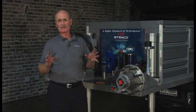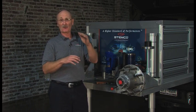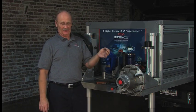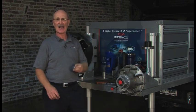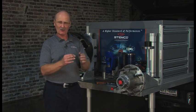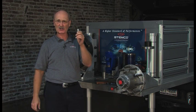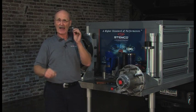For drive axle applications, TMC RP631 recommends you jack up one end, then the opposite end a minimum of eight inches for approximately one minute to allow the oil to flow to the opposite side, then remove the filler plug and fill to the manufacturer's recommendation. Also check the axle breather vent plug. If it's clogged it will build pressure and blow your drive axle seals. If the rain cap is missing, replace it with a new axle breather vent plug.